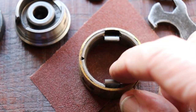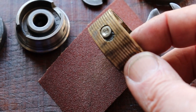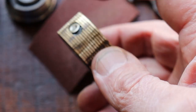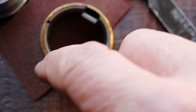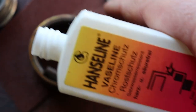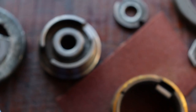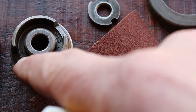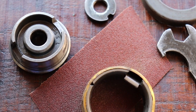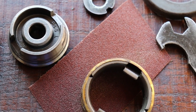Inside a model 102 is a brass brake - that is normal for the 60s. If you want a good brake, you have to work the brake shoe with sandpaper. After this work, put Vaseline on the brass brake - a little bit around the brass brake, some at the noses, and some inside the lever cone. Fill the lever cone inside with Vaseline. When you're driving down a hill and it gets hot, the brass brake takes Vaseline out of this depot.